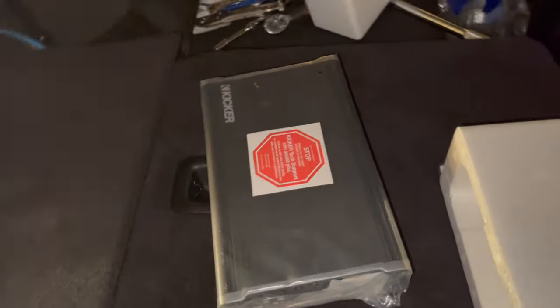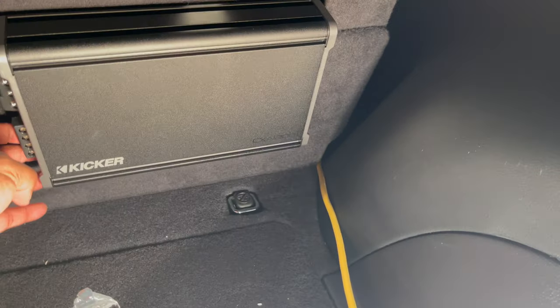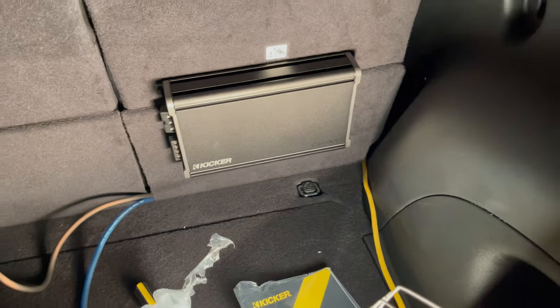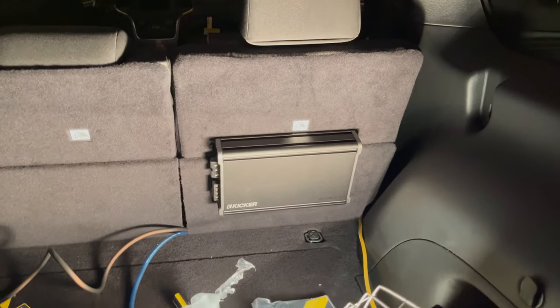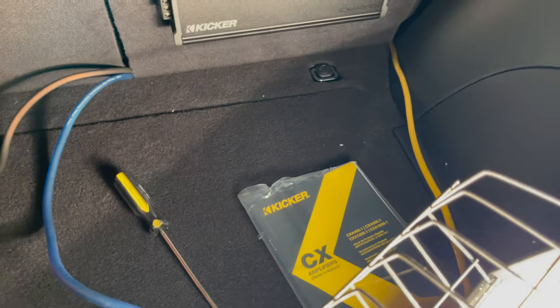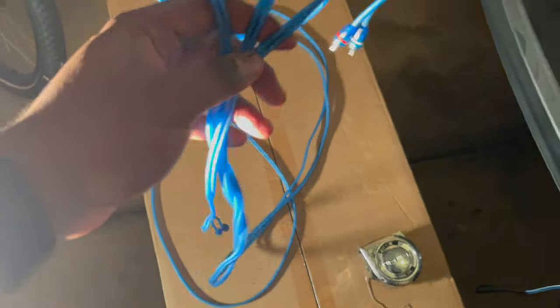This thing is small. I got enough ground wire — I'm going to put the amp above this flat area. I got it mounted to the back seat. The bottom bolts are loose so the seat can still fold down and the flap slides underneath the amp. It's actually pretty secure, and I still have room for my power wire and my ground wire.